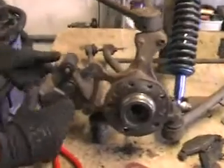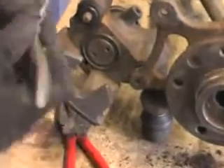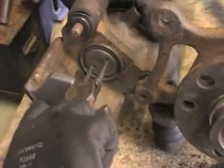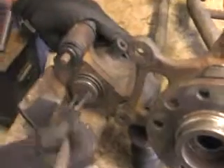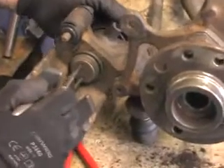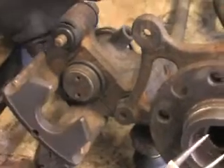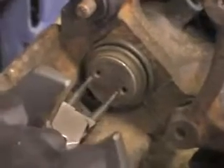To get this piston going in and out — a lot of people want a special tool, but you don't necessarily have to. If you have some circlip pliers like this, it's better to wear thick gloves because when you want to exert force on this, it actually hurts your hands. Basically, you put your pliers in there, hold them, push in, and turn. If you turn it the other way, it comes out. When you want to change your pads, the piston will probably be extended, so you put your circlip pliers in there, push in and turn. You need to apply more force than you'd think.